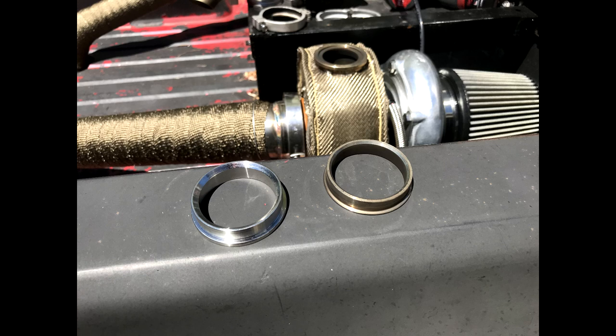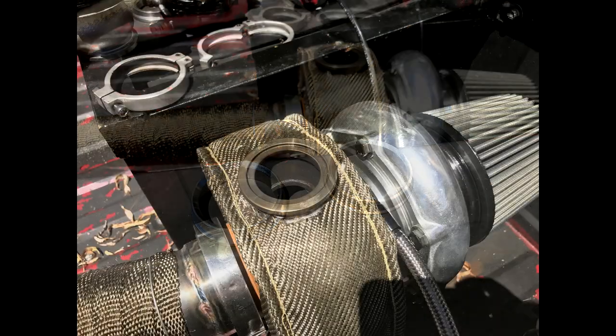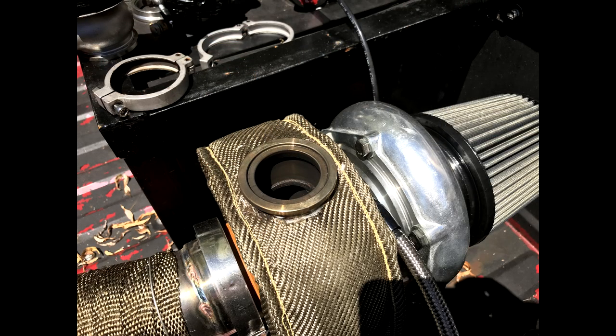He recently had a kid, slowed some things down. We got it on the dyno. And we were able to floor it on Sunday, so here we go. All right, the rest of it is, as you know, 5.3 decaps, Sloppy Stage 2, Pack 1218s, TH400, PTC 9.5, and a Ford 9-inch rear end that has been in since high school. That's really all there is to it. It's pretty simple.